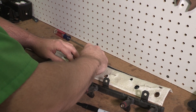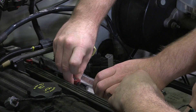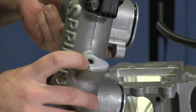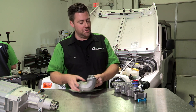If you want more information, we have a full detailed review and installation instructions — you can check out our video that we did earlier. We've gone ahead and taken apart our discharge assembly. We've got our new map sensor installed and went ahead and pre-drilled and tapped a port so we can add a boost gauge. It's nice to take this apart so we can clean it all out and not run the risk of getting any metal shavings into our engine.